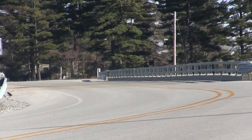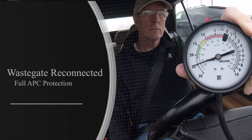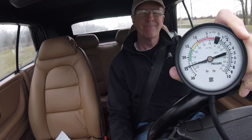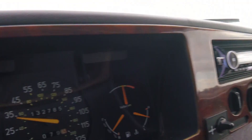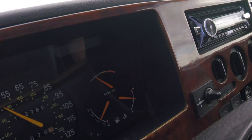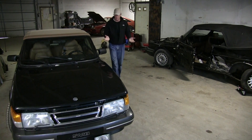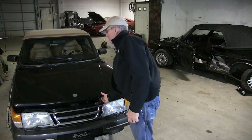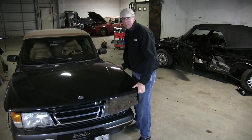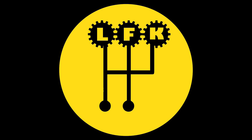Now we're going to reconnect the APC system and see what happens. Clearly, with all the safeguards reattached, the engine's just not putting out that full 12 pounds of boost I'd like to see. We collected some good data today — we know the turbo is capable of putting out its full amount of power, but something is causing the APC to kick in before then and limit the boost. Love to hear your suggestions in the comments. I'll keep after it, and in the meantime, get out in the garage and get yourselves dirty. We'll see you next time.